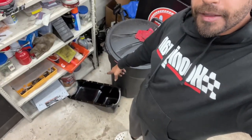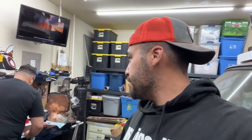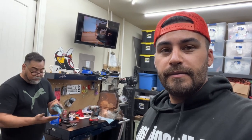There she is — the Mopar 318, for the most part done. I'm not going to lie, it took me about four hours to put the oil pan on. The new oil pan we bought is sitting next to the trash can because it wouldn't line up, and dad had trouble with it before too. So I refurbished the old oil pan, painted it, cleaned up and installed all the gaskets. During that entire time, dad finished installing the Transgo shift kit — smooth like butter, no extra bolts. It's a very easy shift kit to install if you follow the instructions. Totally recommended.